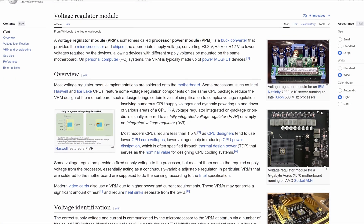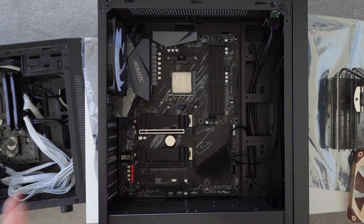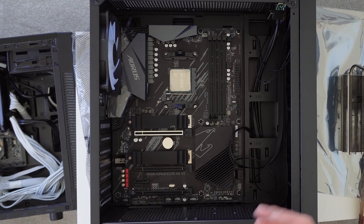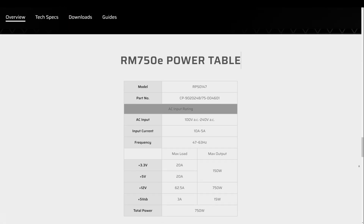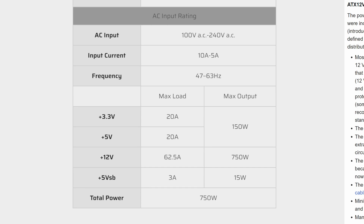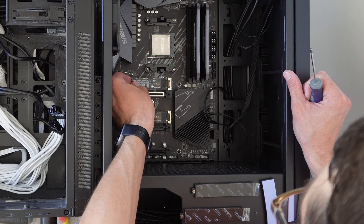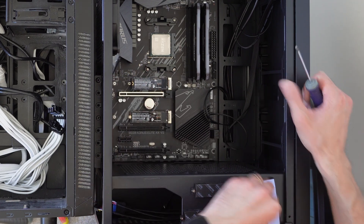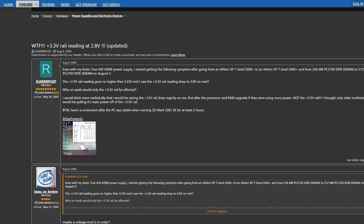So the majority of components would be powered off that single 12 volt rail. This is where the role of power regulation on the motherboard itself has become much more prominent in recent years, with big chunky VRMs added to the motherboard to help manage the voltage delivery to all the various components. However, it's not actually strictly true to say that everything runs off the 12 volt rail. If you look at a PSU's manual, you'll almost certainly see 3.3 and 5 volt entries there. Even though the ATX 2.0 standard from 2003 actually reduced the power on these two smaller rails, they do still exist — your NVMe drives, for example, might actually be powered from one of these two lower voltage rails. But it's kind of up to the motherboard nowadays, and it's not something you need to be worried about.